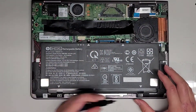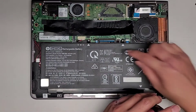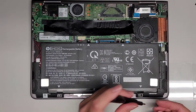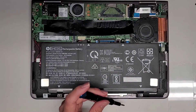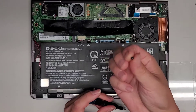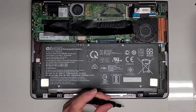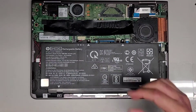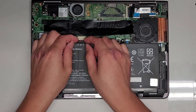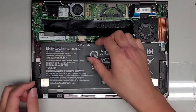We're just going to take these screws out. So there's apparently two here and then there's two down here. I think somebody mixed these screws because that one screw is actually a PH1 or JS1 screw and the others are PH0. So somebody messed with this. I'm going to disconnect the battery — to do that, I just grab the wings and kind of wiggle the connector just like that.